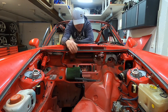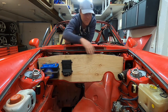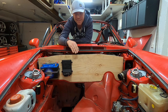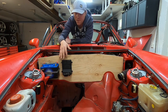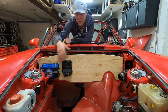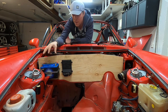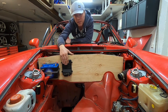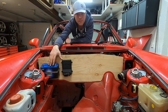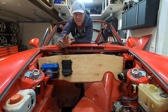Then you need something like a fan box — DP Motorsports has a nice one of those, so I might get one or fabricate something myself. This divider will probably be made out of carbon fiber in the end; it will close shut towards the two sides and carry the original seal so this area doesn't get rainwater — which is very important. It's going to carry the PDM that will distribute power to all the things in here as well as connect to the instrumentation and the ECU. The battery will have a routing back to the starter and generator. This is not heavy — one and a half to two kilos — so it doesn't affect the center of gravity much.